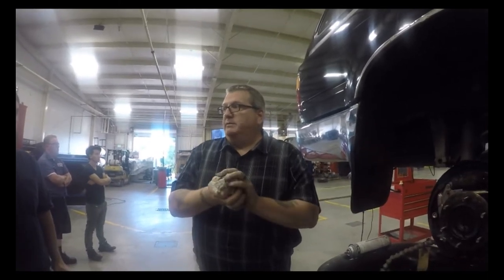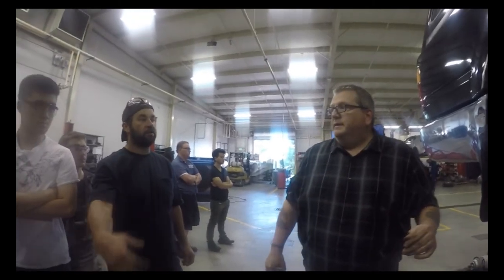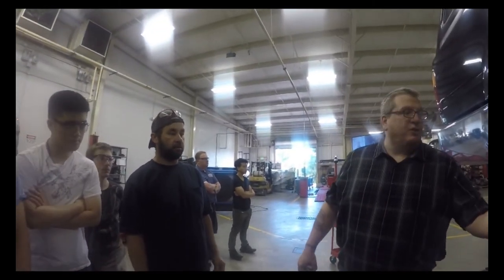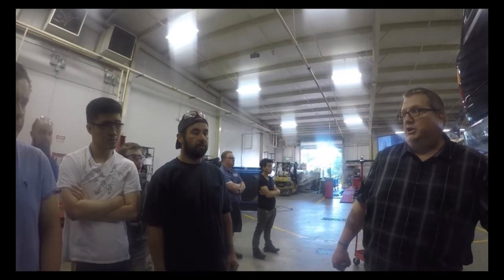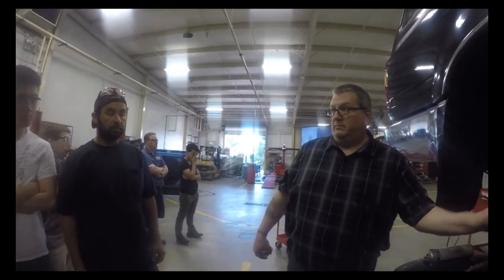It's uncontaminated. So even if you got grease on the shoe, you clean it up and, let's say it's already soaked in. If it's soaked in, there's nothing you can do. You can clean it off with brake clean all you want, and all you'll get is the surface stuff off, but you won't get it beyond there.